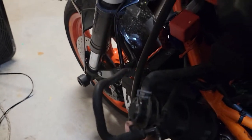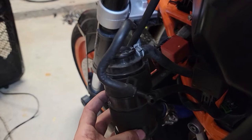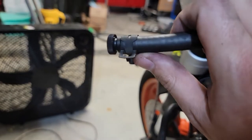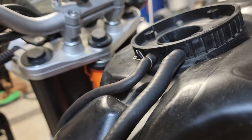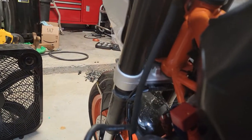This is the canister right here, and there's also a solenoid inside of there as well, which I'll show you in a little bit. The kit comes with a cap, so you cap that line off which goes up to the tank. There's also an overflow which can act as a vent as well. For the Duke, I don't foresee it being a big problem, and that line is already fitted, so no big deal.